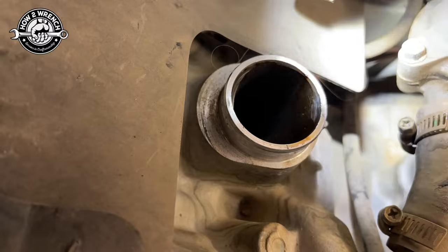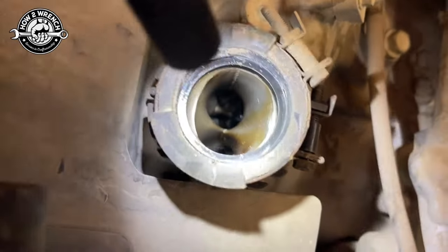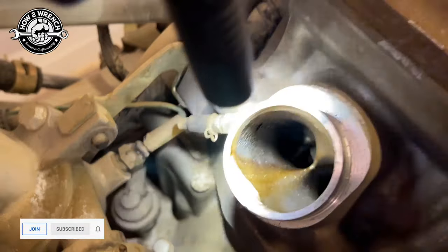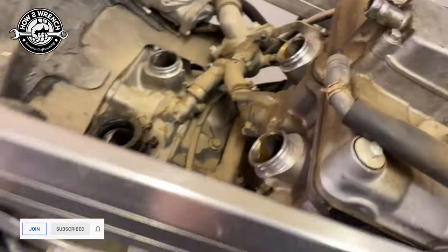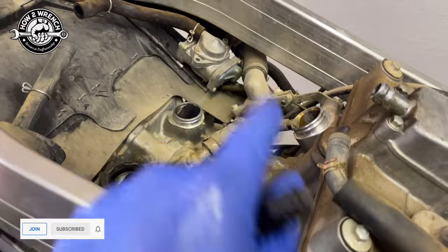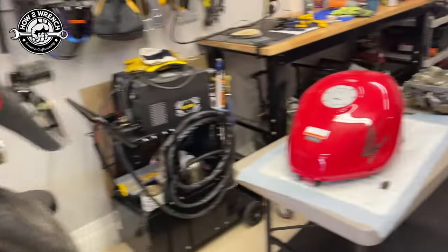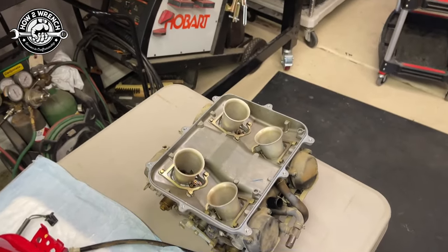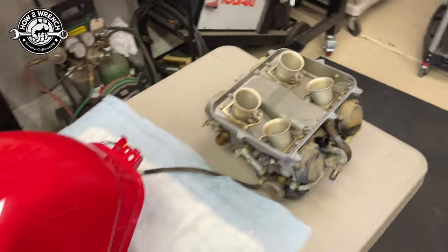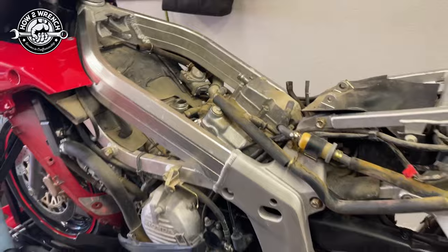What we could see is the streaking. That's not super alarming at this point, but I want to talk about it a little bit. You could see that all four carburetors leaked fuel — drip by drip, down into those intake ports. You should do that inspection on every vehicle, because it tells you about the integrity of the float needles when it was parked. They can fail over time — heat, dry rot, ethanol, a million different reasons.